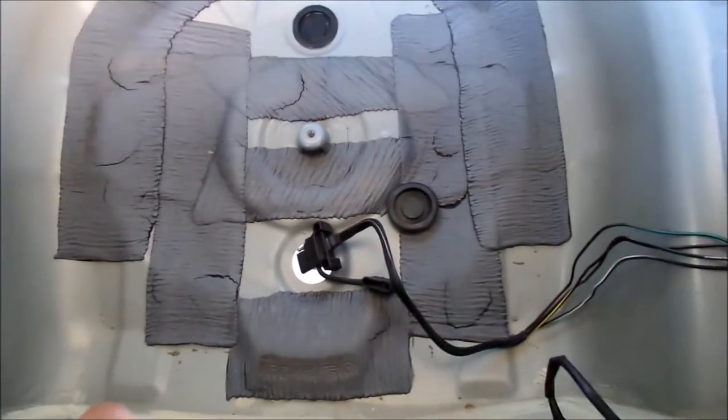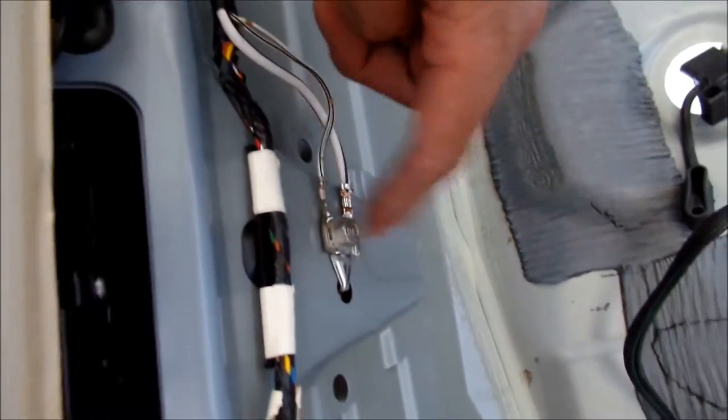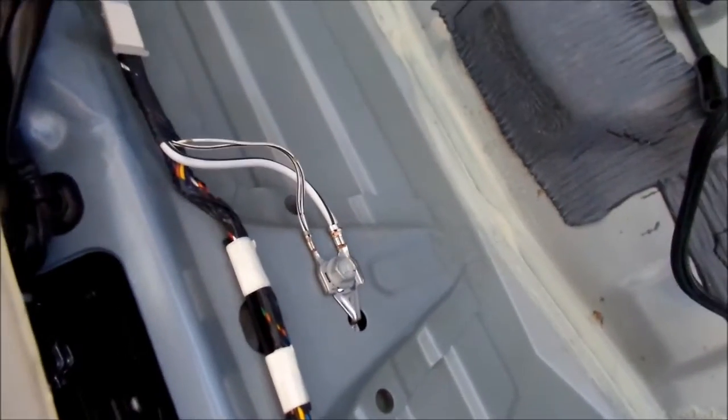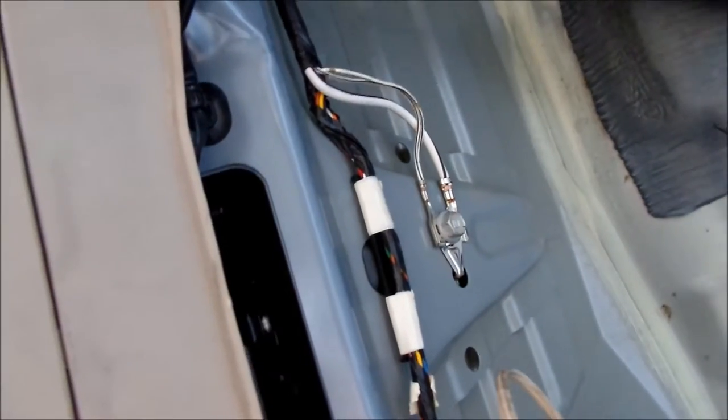The hitch is another good two feet out when you're towing stuff. But I see this wire running here that goes up — I'm sure this is the signal wire right here. I just have to figure out what wires are what. There's also a ground here already, so I can utilize that. Time to get the test light out. I'll tap the wires right here because from this point it'll definitely be long enough.